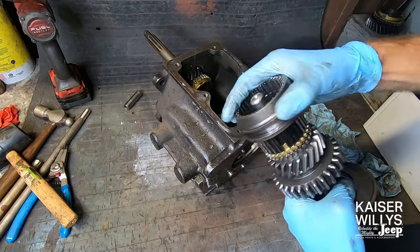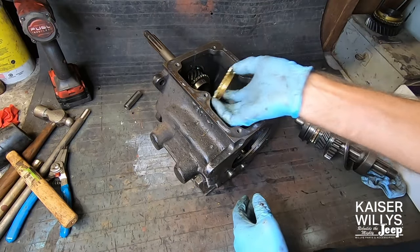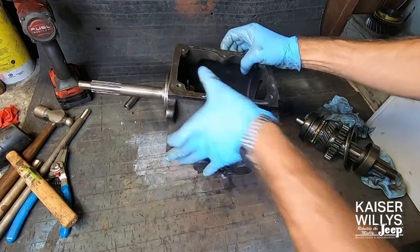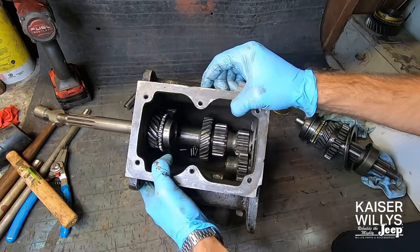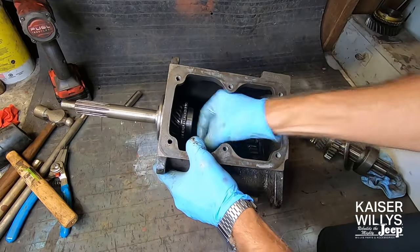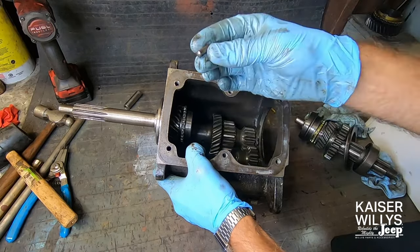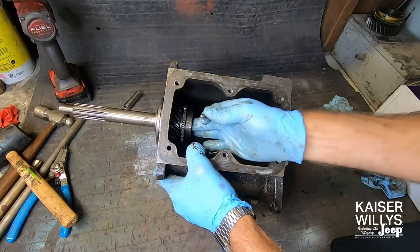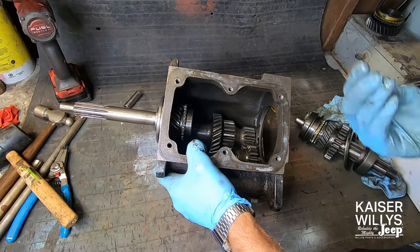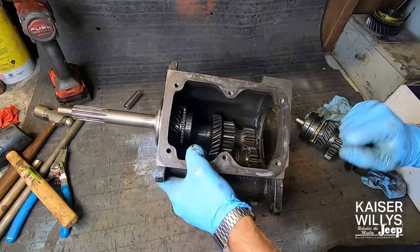My shift collar fell off — that's totally fine. That goes on here, and you'll also be able to remove the input or the third gear synchronizer, so you can take that off and already the case is getting more empty. You can see the little needles. There were a group of these inside the input shaft, and that's what falls out when you remove your transfer case. That means you'd have to pack them in here with grease and carefully reinsert that main shaft, which can be done with the transmission in the vehicle — it's just a pain and not a fun time.